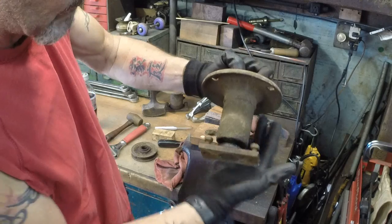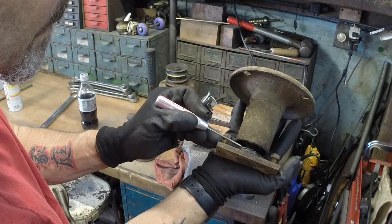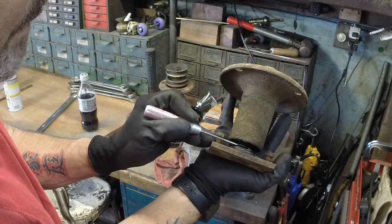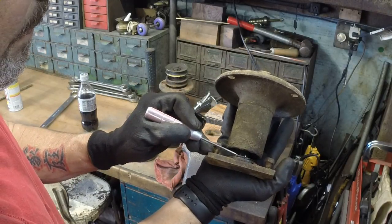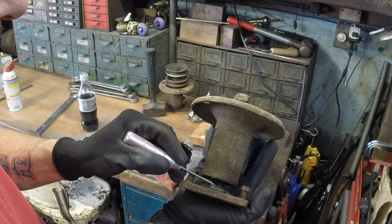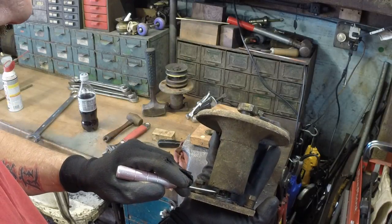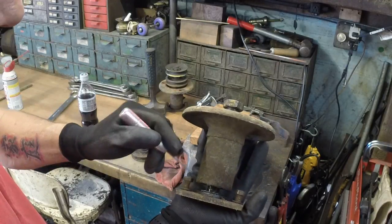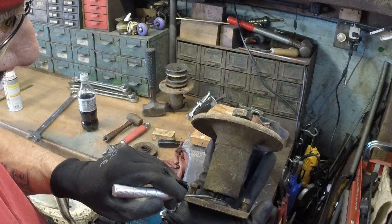So there's our gap. Down here we have really, really thin thrust washers stacked up in there — that's so that they're spaced and gapped right. You can just leave this stack alone when you pop that shaft out. Just leave that be, don't do anything at all with it. Clean the surface, but when you put it back together you've already got that stack correct.